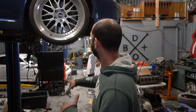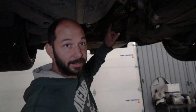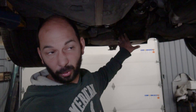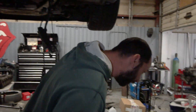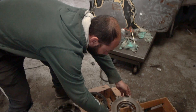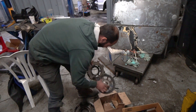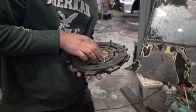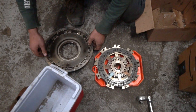So what we've done so far is we put E60 M5 brakes on it. We put an E60 M5 LSD in it, which took it from a 323 open to a 362 limited slip. The other thing I did was put the clutch setup out of an SMG E60 M5 — it's a twin disc setup that looks like this. I have all the pieces here. So you end up with twin discs, two discs, a center friction plate, and then the actual flywheel or pressure plate here.